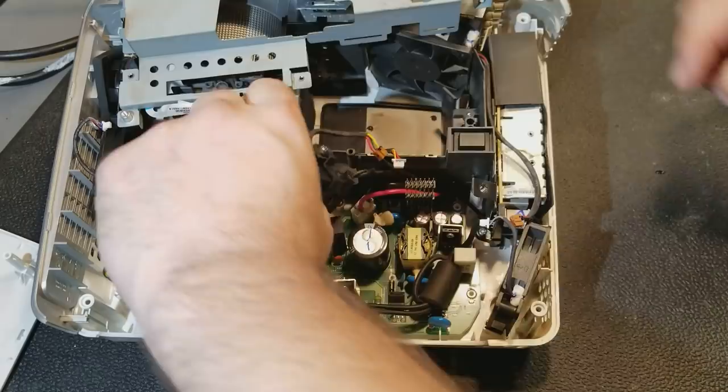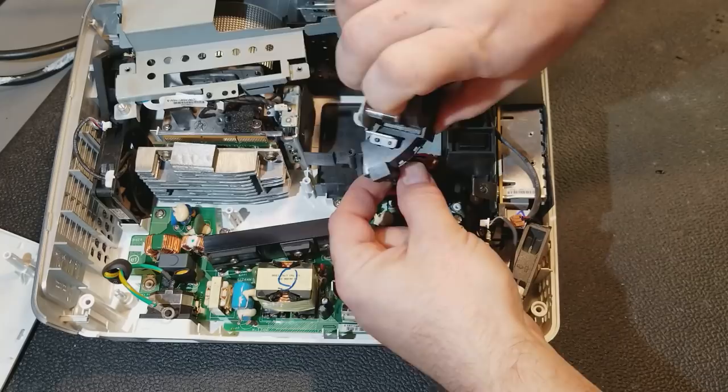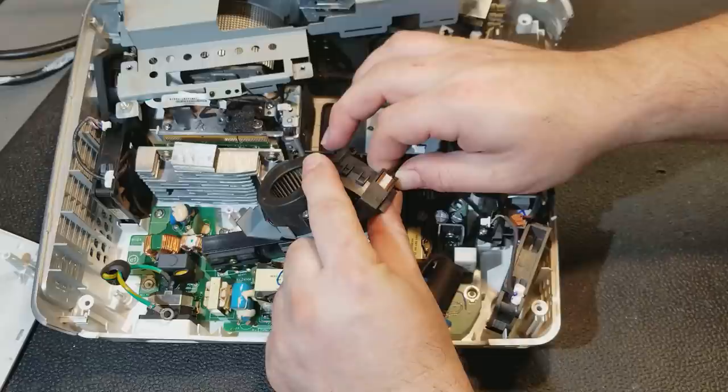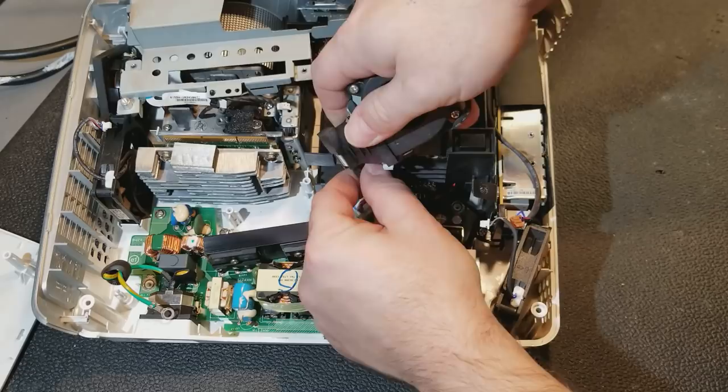Here is a thermal fuse, a thermal switch. This thermal switch here breaks the circuit if it gets too hot. This one is rated YS, let's say, part number YS11A95R. So I'm going to say that's a 95 degree C thermal switch or thermal fuse.